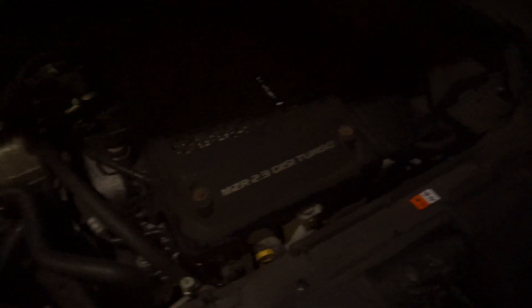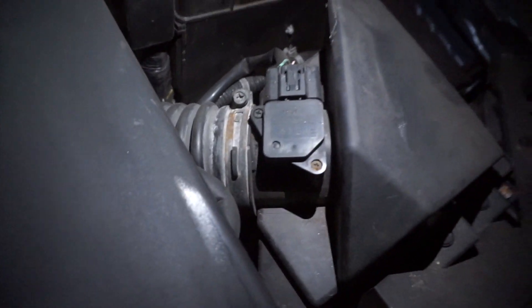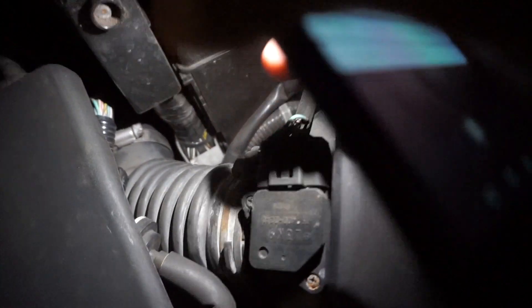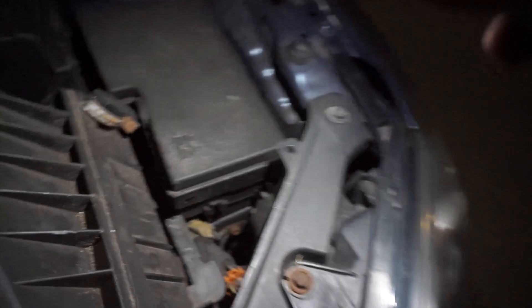So this is obviously the engine bay. You can't really see over this side where the filter is, but first of all we've got to remove these two bolts here to get the case off, and then we've got to get the bolts out from behind here. The MAF sensor is attached to the box, but luckily he's bought the extra MAF sensor adapter. That bolts off down there, and he's got the hard pipe to replace that, and I think there's just a couple more bolts down here that we need to get and then it's all coming out.